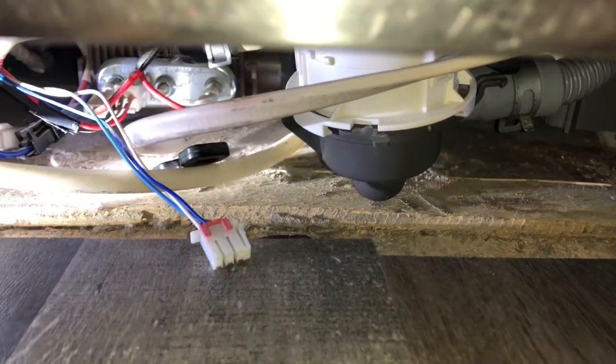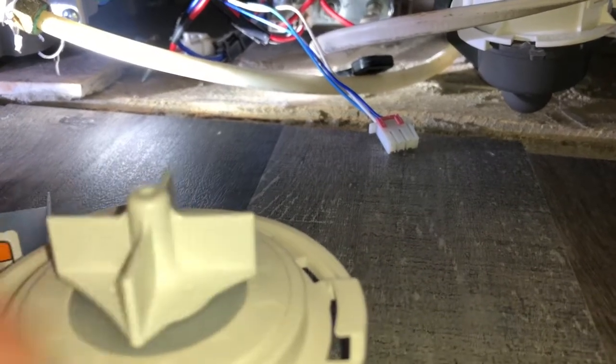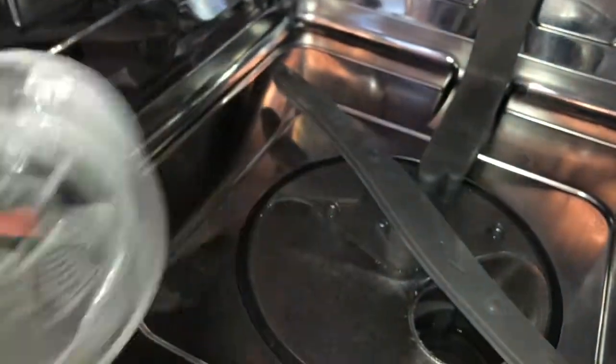Just remember mine isn't going to work because I've unplugged it. But normally hitting DR forces the pump to drain any water stuck in there. My pump was still running but on its last legs — not strong enough to pump the water out in time, which caused the OE error code.